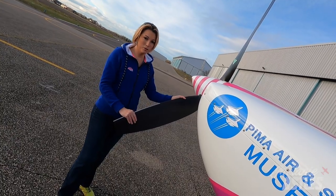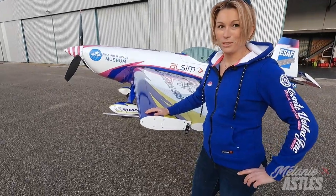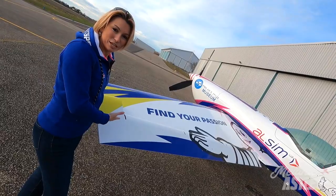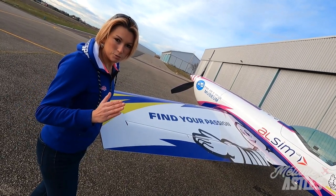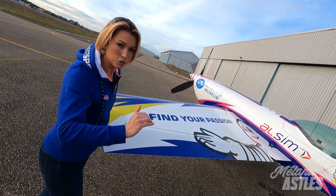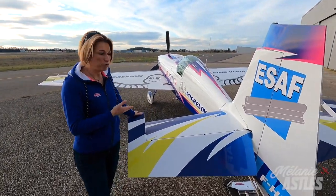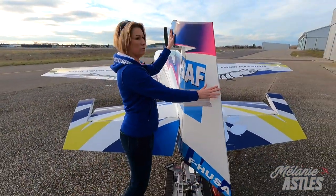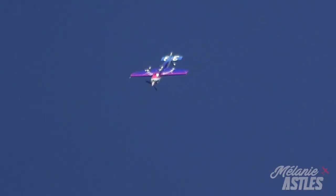This propeller has very big blades and it helps catch the maximum air possible, which is very efficient — just like big wheels on a car. The wing on this aircraft is symmetrical, which means it can fly as well in level flight as in inverted flight. The ailerons are over-dimensioned, which means the plane can roll at 420 degrees per second — that's about one and a half rolls in only one second, which is huge. At the rear of the aircraft, same story: the controls are oversized, and you can see here and here very efficient controls which help you make amazing freestyle maneuvers.